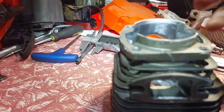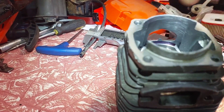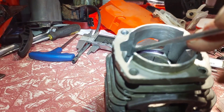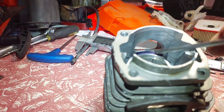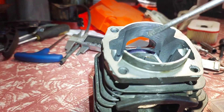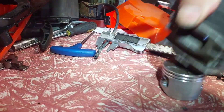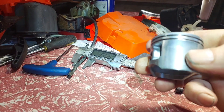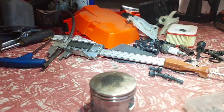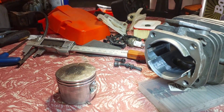I've worked out you put the piston in the cylinder and just drop it down to bottom dead centre. You can see how much restriction there is on both sides. I'm going to do what I call 'Mickey Mouse' porting — I'll chop these out a little for more airflow to introduce more air and fuel. Got to be careful though — there are pins on the piston that hold your rings in the right spot. If you go too wide you'll have problems: the ring will fall inside your intake.